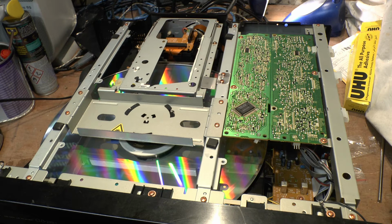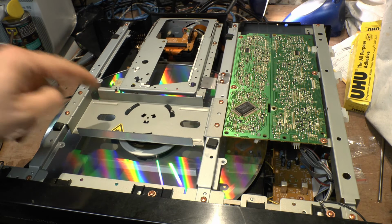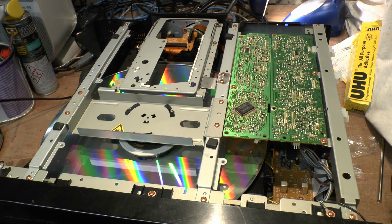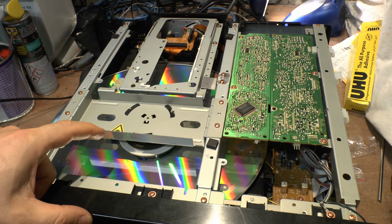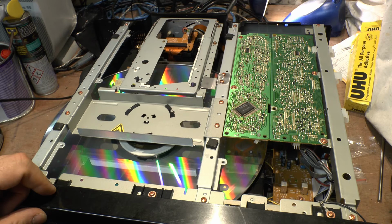So I'm hoping you can see that turn mech in the background there. So I'm going to press play now. I noticed that this has the same glitch as the other one that wasn't working for me. And that glitch is basically, there's a scratch on this disc. And I noticed that the more modern lasers that are in good nick sort of skip over, and I get no... Hold on. Just pause it. So I noticed that the more modern machines, I don't seem to get any skip or hop or jump over that scratch. Whereas on this machine here, it basically jams on the full on. It also jams on the CLD-4300. So they're looking for a very perfectly flat and perfectly smooth disc with no undulations or gouges or cracks.